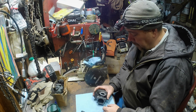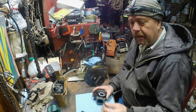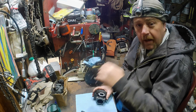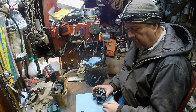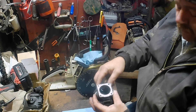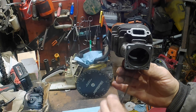You can get someone's timing numbers — they might tell you exactly, they're not hiding anything — and they're telling you duration. But they're not telling you the lift. The lift and port shape — like a three-angle valve job on a car, or different heads that flow better because of runner shape inside the head — that's also what you're dealing with here.